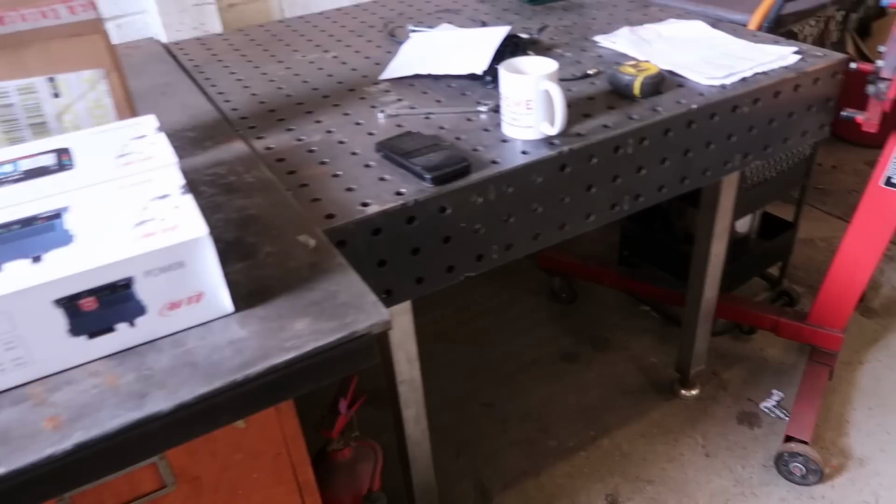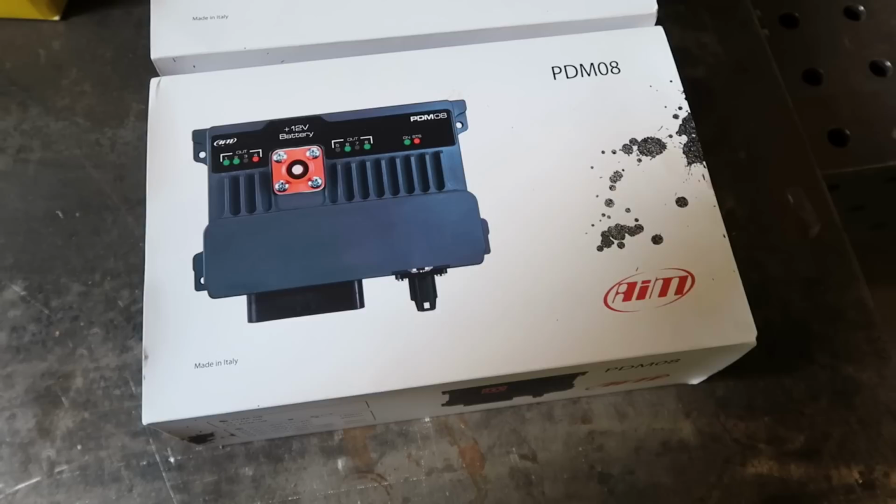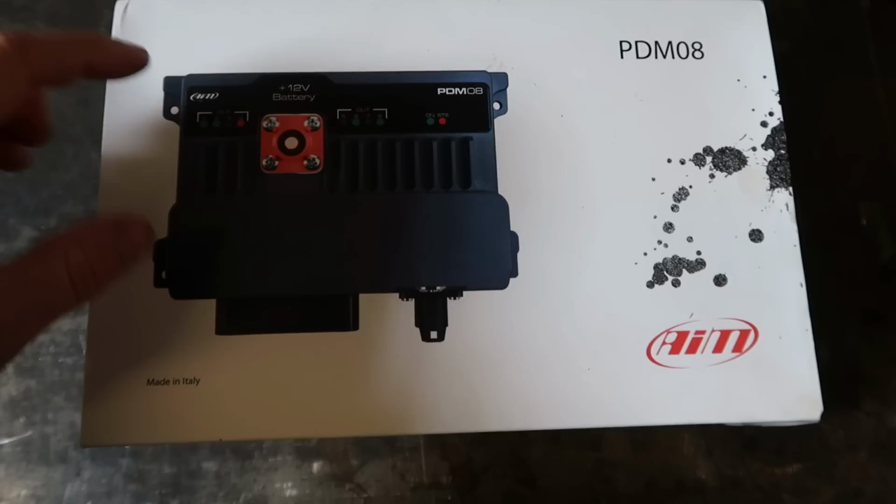And they've now sponsored me this PDM setup. What this will do is run all the electrical systems in the car. You don't have any fuses, relays, anything like that. This controls everything. It also logs everything. It monitors every output. It also logs lap times. It's also a digital dash.